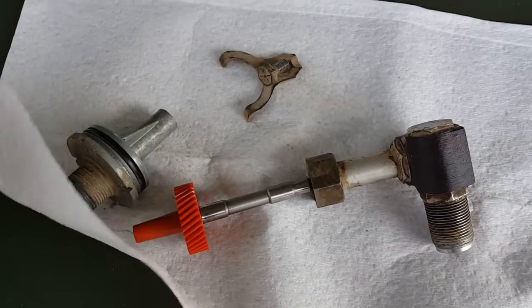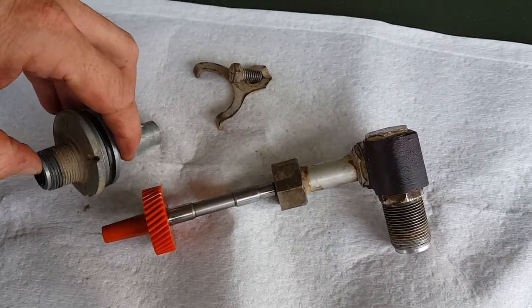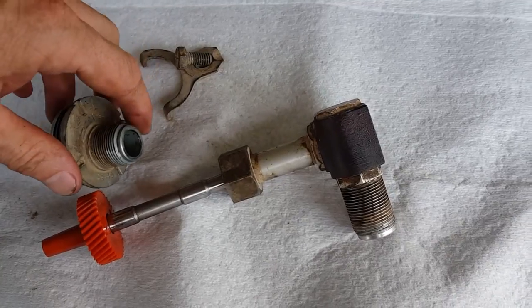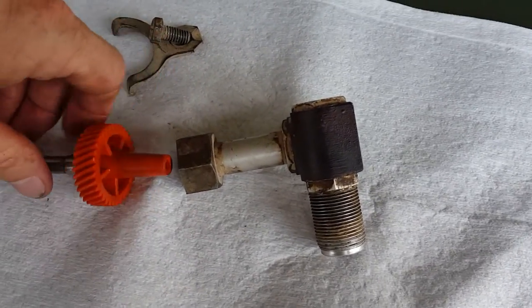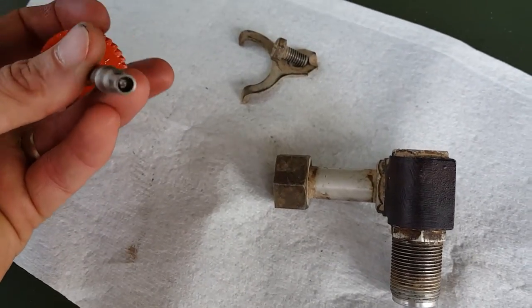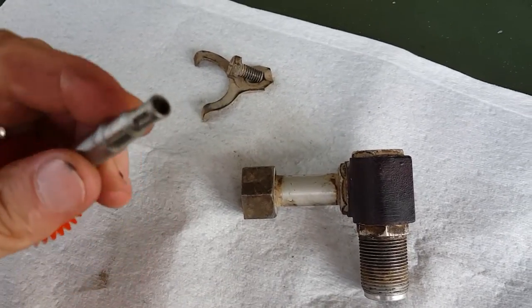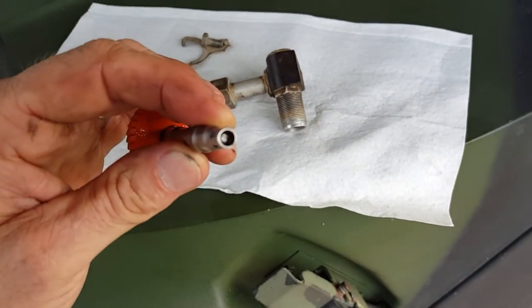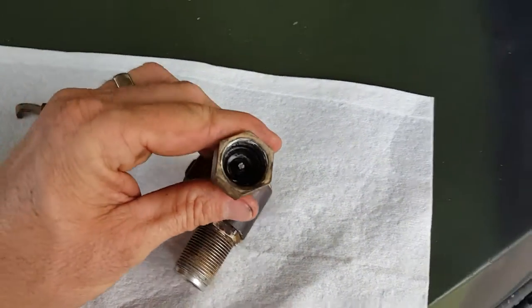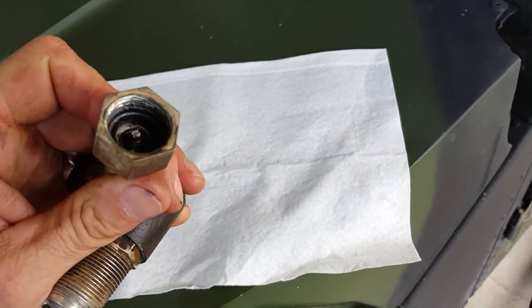I went a bit further and took this off — this fork which holds this on. Your orange gear there, which usually has broken teeth — the teeth look good. It slides through here. The only thing I could figure is this looks really shallow. The hole should be deeper. I think the shaft broke off in it, because this shaft seems pretty short and kind of jagged on the edge.